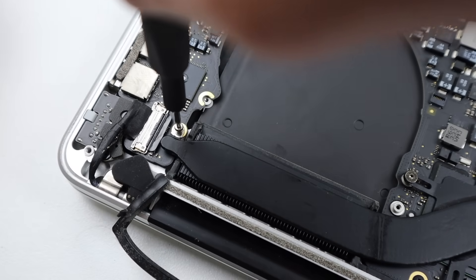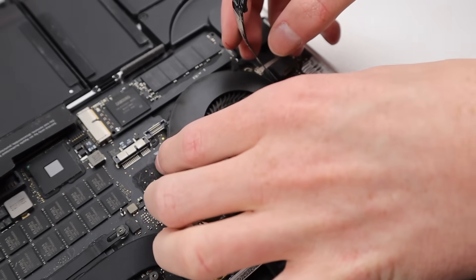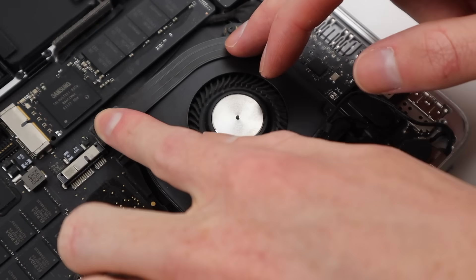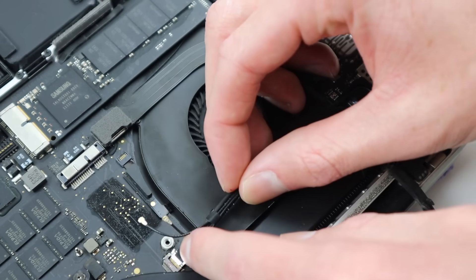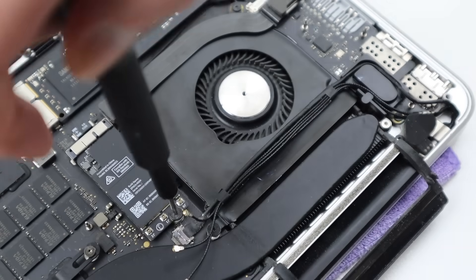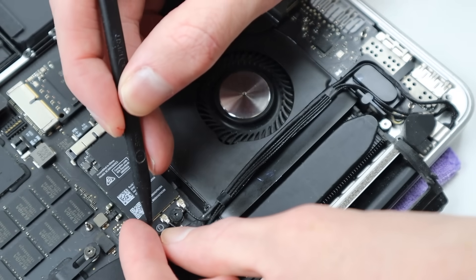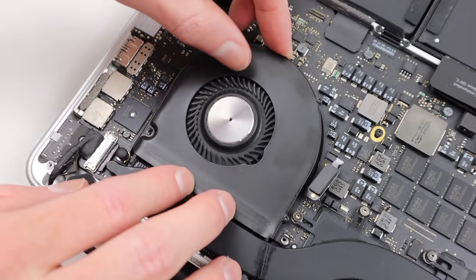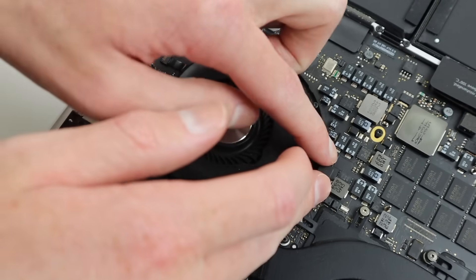With that done, we can install two more screws for the heatsink and then it's time to put the fans back into place. I'm going to start on the right-hand side, line everything up correctly, connect the flex cable, and install the three screws. Then we can go ahead and route the airport and camera flex cable wires and connect up the webcam itself, reinstall the Wi-Fi card and its appropriate screw, and connect the three antenna wires. Making sure to put back the piece of rubber, we can move across to the left-hand side — this fan is much simpler to connect, just a flex cable and three screws.